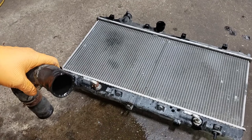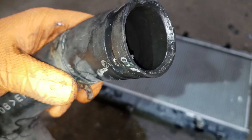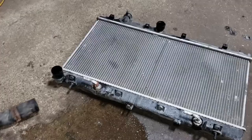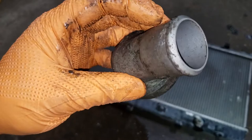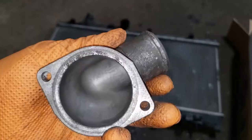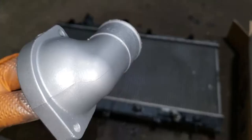With the hose, you should end up with a result where most of the white crud is gone — it's a little bit rough but there should be no protrusions. If your hose is cheap enough you can go ahead and replace it; this one here isn't in stock, so we're going to reuse it. For the aluminum piece, scrape off most of the big chunks with your flat screwdriver and then get a wire wheel or wire brush and etch the rest of the aluminum. You should end up with a clean result before paint — make sure you get rid of all the dirt and crap, then go ahead and paint it.